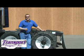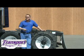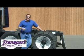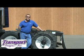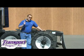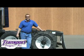The other thing I want to caution you about is, as you're doing this process, you're going to be in and out of the truck a lot, and I've done it myself. I've seen other guys do it. You're just in a big hurry, you got the blood flowing, and you forget to set the parking brake. I've seen trucks roll away when guys are chaining them. They just get in a big hurry and don't set the parking brake. So make sure you're setting the brakes each time you get in and out. Roll forward, roll back, whatever you got to do.